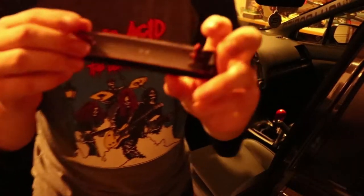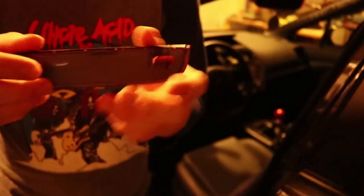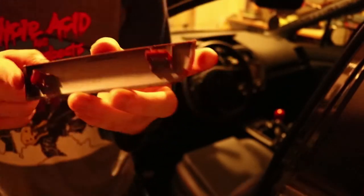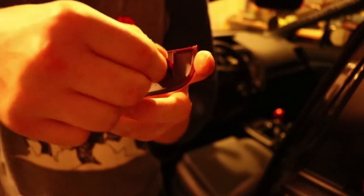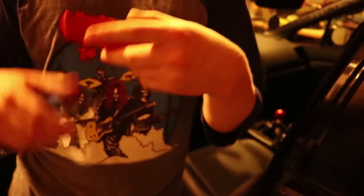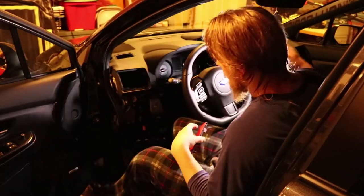Here's the little trim piece for the driver's side. My mud flap is kind of dirty so it's not the best comparison, but it's pretty similar. It's not quite the shift knob red that I have, but this is a very Rock Blox red type of color — it does look very good. Now, I didn't explain how to get this piece out. What you want to do is push this part in and it's going to release. Then all you have to do is push up on this and you can pull out. It may even fall out.